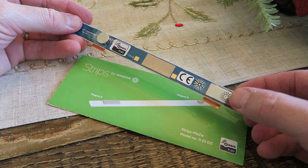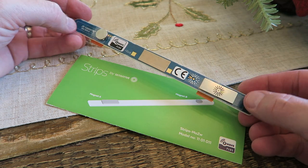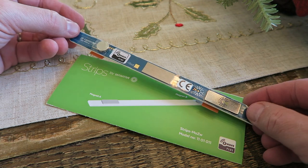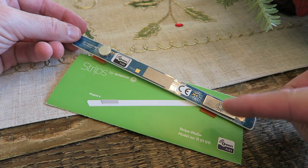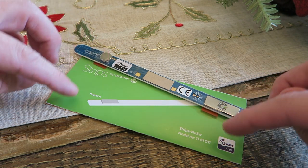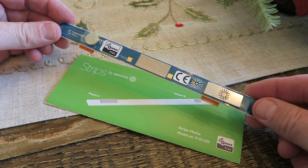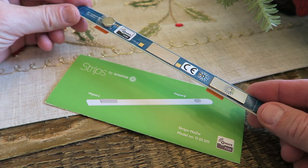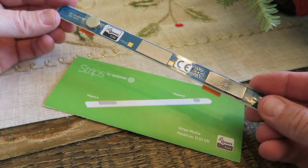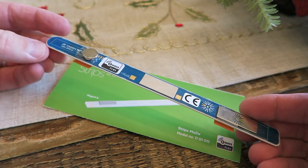It comes with the strip and has a magnet on the back that serves as the door/window sensor magnet. The two magnets are also involved in pairing, inclusion, and exclusion. When you get Strips, all you have to do is take off the pieces of tape, put your hub in inclusion mode, and pull the magnets off — the hub should see it and include it. If you need to do exclusion or a second inclusion, you follow the directions for a magnet dance. It has a 10-year battery and it's weatherproof.